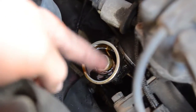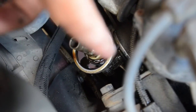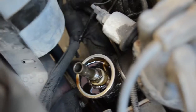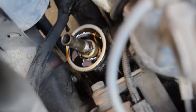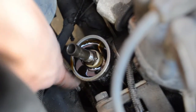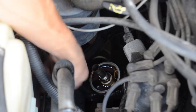You can now see down here better — that's where the filter goes, and you can kind of see back behind there is the elbow. You can see all the oil and gunk on there. Right where my fingertip is, there's a bolt. In my case, it's a 5/8ths. So you're going to need a 5/8ths inch socket and ratchet, and you're just going to back off this bolt. Once you do that, the whole thing should just come right off. I already got it loose, so we're just going to start backing it off to a point where we can spin it off with our hand.